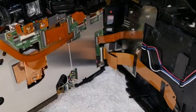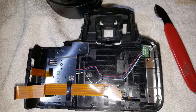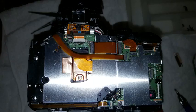On the FFC side of the FFC connectors there is a little flap. Insert a spudger under it and flip it up away from the FFC. Once open, the FFC will slide out easily. Disconnect both and place the back safely to one side.